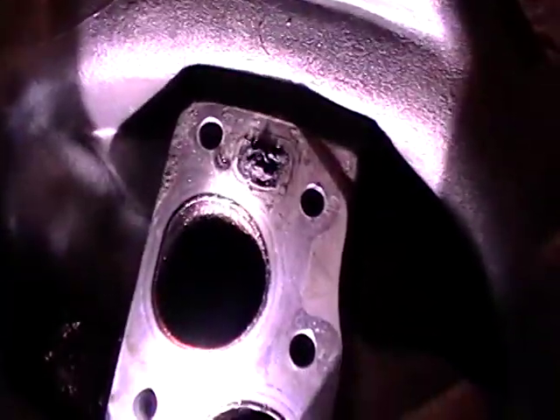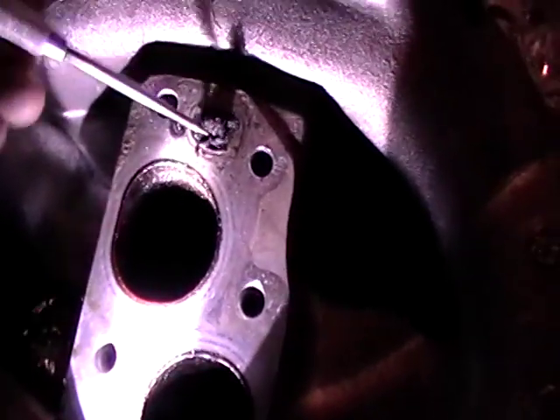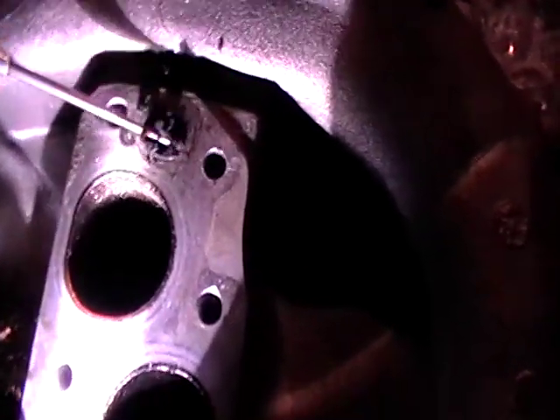We removed the intake. That's where it is. As you can see on the right side over here, this thing is pretty clogged up. That's where all this stuff is, and it has to be all cleaned up. Also over here, same thing on the intake manifold — all this stuff, it's pretty heavy. Look, all this junk comes out.